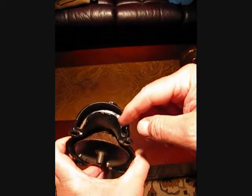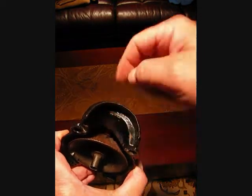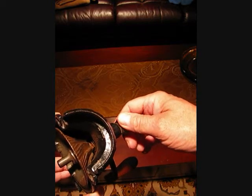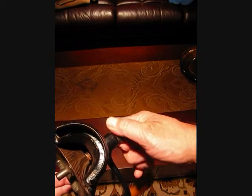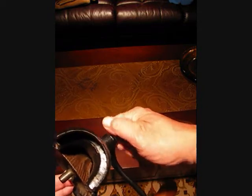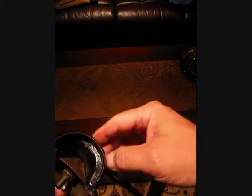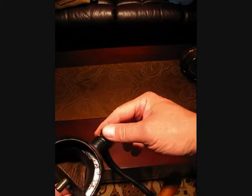This is what grinds this plate up against the body to crush the beans. Right in here, when you turn the knob, you will see this is on the coarsest setting. As you turn the adjustment knob, you'll see it getting tighter and tighter and tighter, until we're getting into the fine espresso style grinds, which are pretty much the finest. That's the adjustment knob I was speaking about.